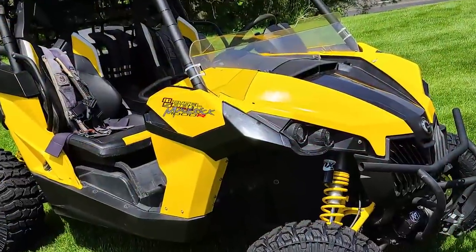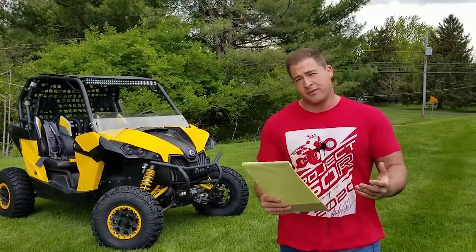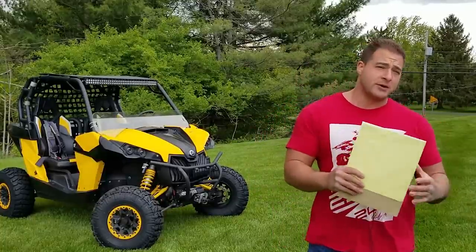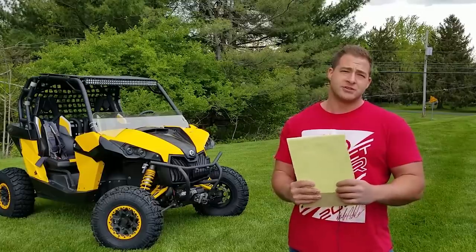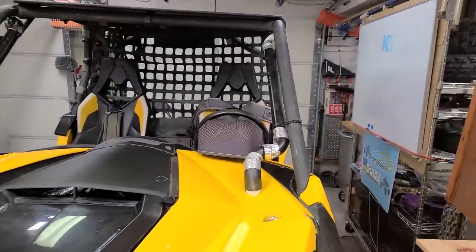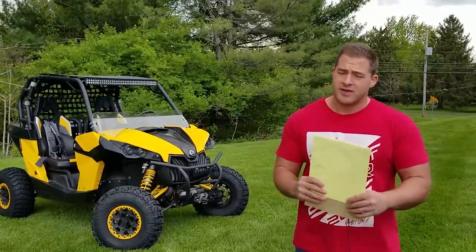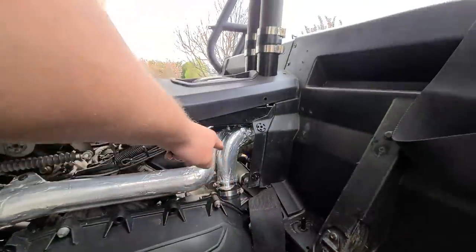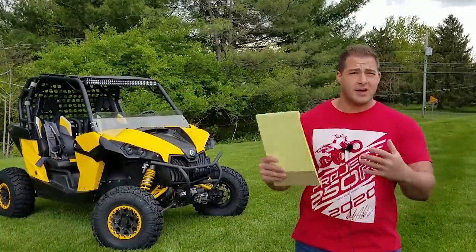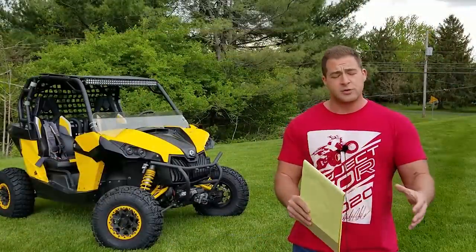I've got some custom decals too — since I sent stuff out for Project 250R I had the graphics company make some custom stuff for this as well. Now, while I was poking fun at a lot of stuff on here, some of these parts were actually really detrimental to performance. The snorkel systems were like really long and intricate — they were also sized down, not even the OEM diameter. The more I've learned about CVTs, it's really important to keep the CVT super cool and maintain good airflow, so those things were super restrictive. We removed all of that and put most of the OEM stuff back.